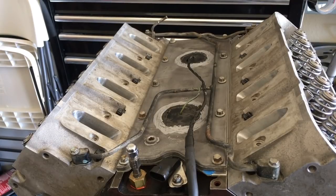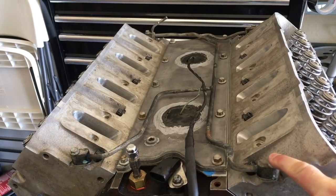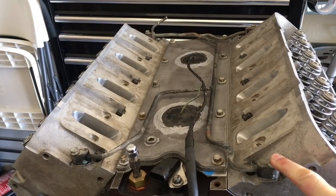I just want everyone to see that there's nothing wrong with sealing those with silicone RTV, whatever you have available. That way it'll eliminate a great portion, if not completely eliminate getting watered. The bolts that do your coolant bypass — these bolts torque to 106 inch pounds.